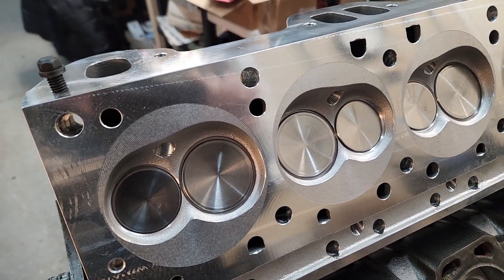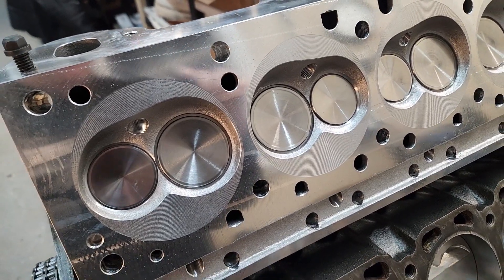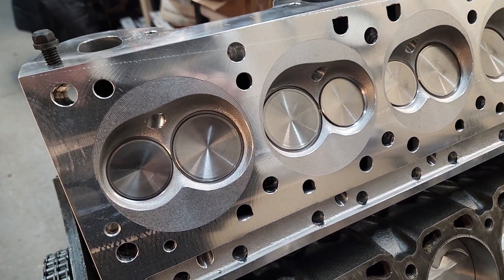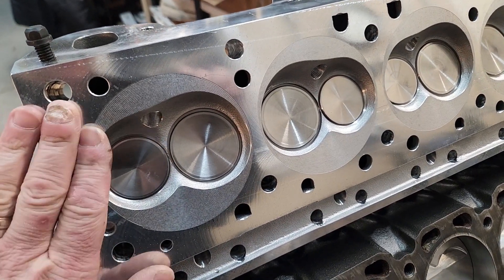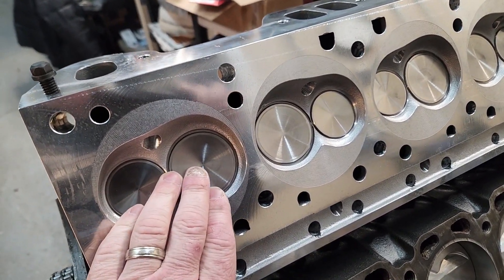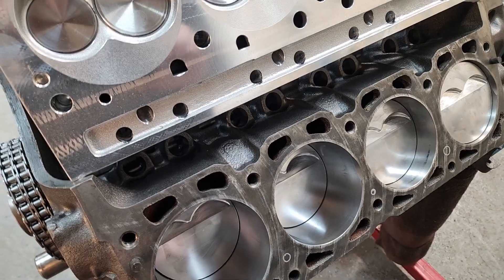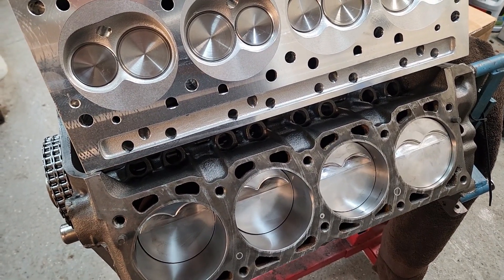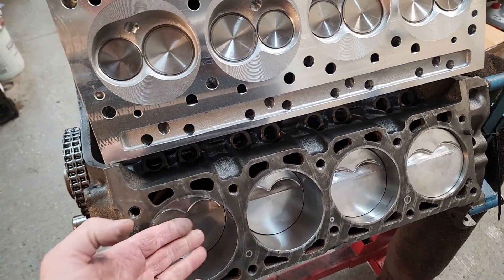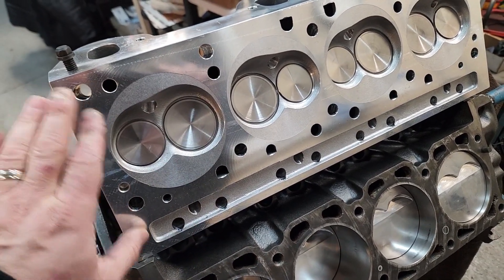That's in a non-turbo application. The turbo applications dish the piston and put it down to about 7.5-to-1. Since we're dealing with an aluminum cylinder head, you can usually go higher in the compression ratio because aluminum can dissipate the heat much better and more efficiently. Talking with Jeff at Kaufman, he said he could even shave the cylinder head down and tighten up that combustion chamber even more. I was trying to get as much compression as I could. Compression is really based on bore size and stroke — 301s are just a 3-inch stroke, and we have a 4.030-inch bore in this case. Without using a domed piston, we're trying to get as much compression as possible, so he shaved the head and that made the combustion chamber smaller.